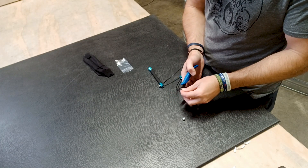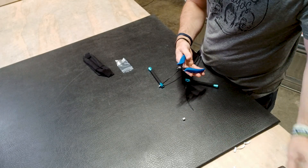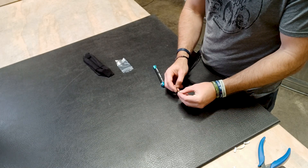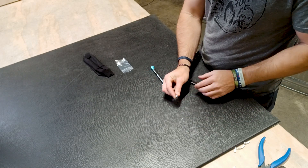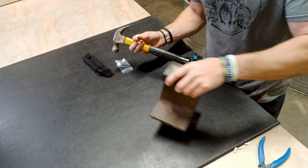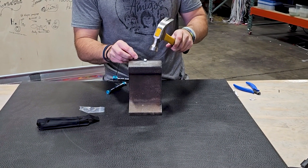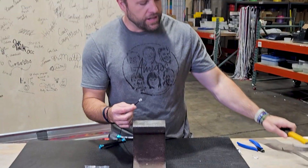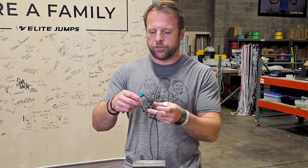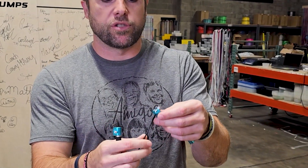Let's say that's the excess you want to cut off. You cut off the excess cable so you don't have some free-spinning, and you'll put the cable stop on the end like so. These are handy to just whack on — I have a hammer and a little anvil here. Place that on there — that's on there real tight now. And now you'll see that both ends are free spinning, which is what you want.